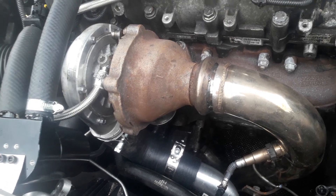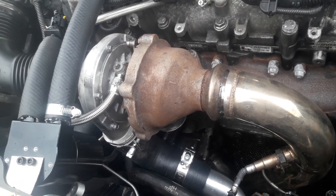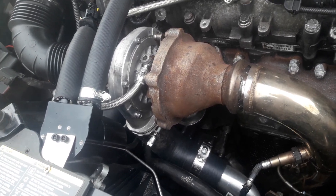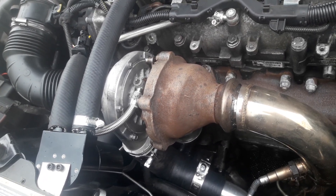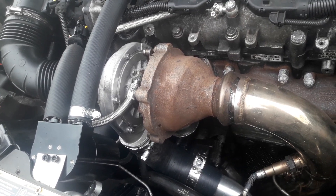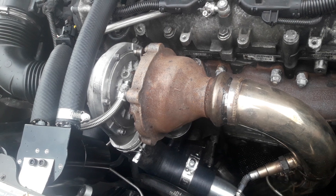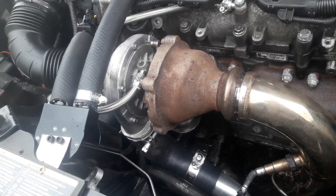The car is drivable — I have driven it. It's had its first remap and it is quick. It spools better than the original turbo. The standard turbo starts to produce boost around 2100 RPM, whereas this turbo produces boost around 2000 RPM and might even do it a little bit earlier with some additional mapping, but that's yet to be proven.